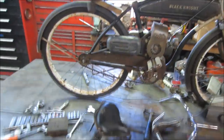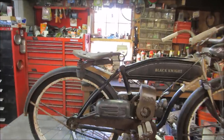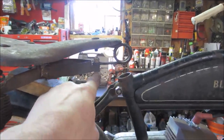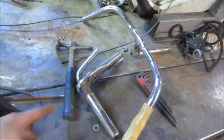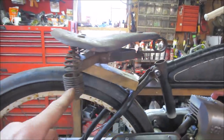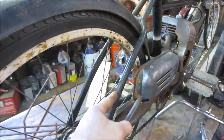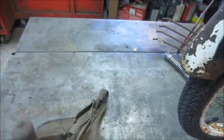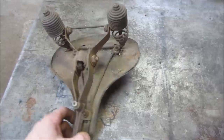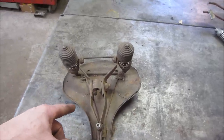I had the bars on there and was playing around with the two seats on the bench. I'm kind of liking the longer one now - if I could put it roughly in that spot it would be fairly decent. I was trying to make a tube that comes up and attaches to the original mount, but what I might do is come off this one, slice it down, weld a steel plate that goes right to this bolt, grab that front mount, come straight down and tap into the frame right there. The center's all bent up anyway - it's not like we're trashing anything historic. Let's take these three out, separate the pan, and maybe get some black leather to make a cover for it.